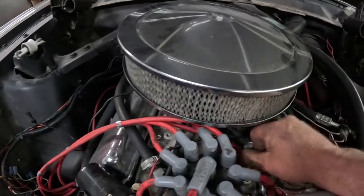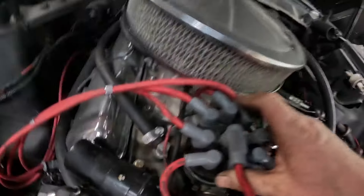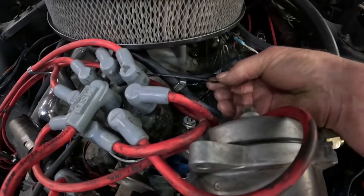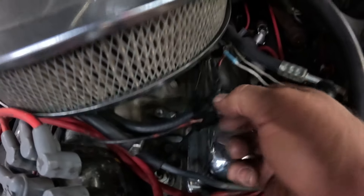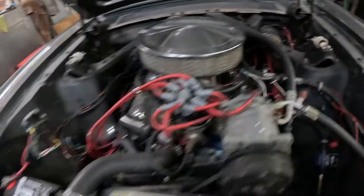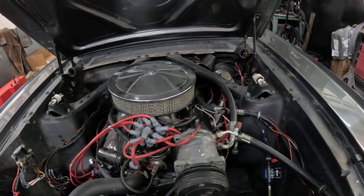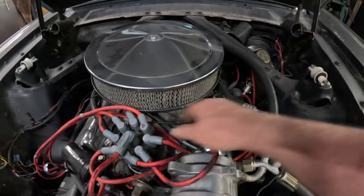It's just a mildly dressed little engine with some headers. We've got the old-school alternator — that's clearly not working, so we're going to change that out for a one-wire alternator and get rid of the external voltage regulator. It's been upgraded to the Pertronix ignition, but the trap so many people fall into: this is the original factory wire, which is not heavy enough. Behind the firewall it's got a resistor wire, so that's a 12-volt electronic ignition running on seven, eight, or nine volts depending on how much the resistor wire is dropping. I guarantee that hasn't been changed — if it had been, they'd typically run one wire from the back of the key all the way through to the coil. That needs addressing.